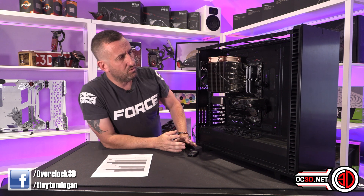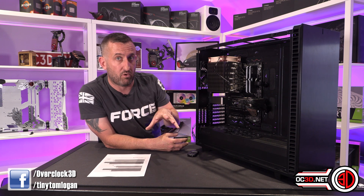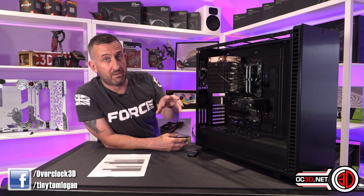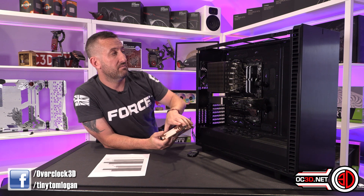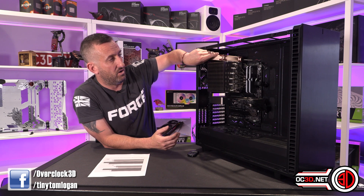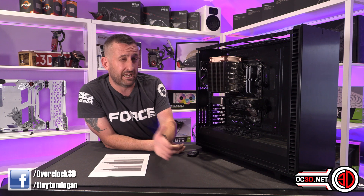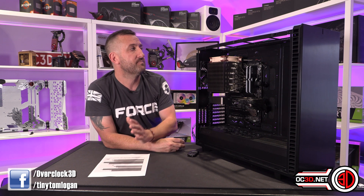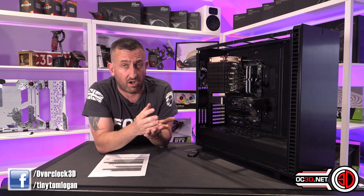The numbers are all there and I'm genuinely surprised how well it coped with the i9. I personally think it's better with something like an i5 — something a little more mid-range — because with a mid-range CPU you have the possibility of going passive if you want. I would personally advise, for anyone other than the most extreme confident users, to have that fan set up with a spin-up threshold really, really high, so if it ever does get really warm, that's the time it kicks in.